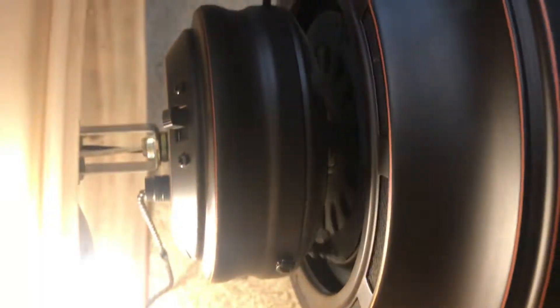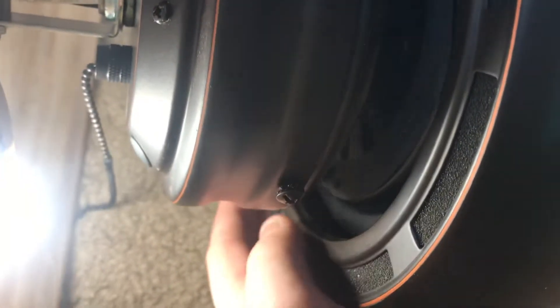And there's the blade brackets. This one is broken. The capacitor is bad, so we'll turn it on. It slowly starts up. Let's try and spin it the other way and see if it'll spin the other way. So the capacitor is obviously weak on this thing.